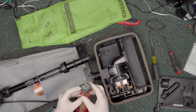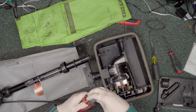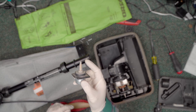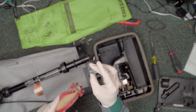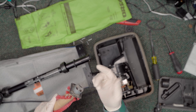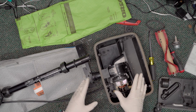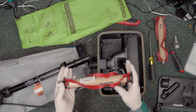What I saw on the base plate indicates there might have been some sort of catastrophic failure — and that's not good either. This brush roll needs to be replaced. This is the dowel that is supposed to be driven down inside the brush roll, and it just popped out. It's not supposed to do that. Once this happens there's really no going back — if I put it in with epoxy it may not get square, it'll be off-kilter. So this is getting a new brush roll.